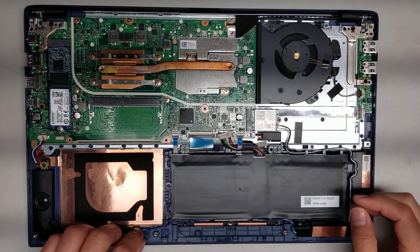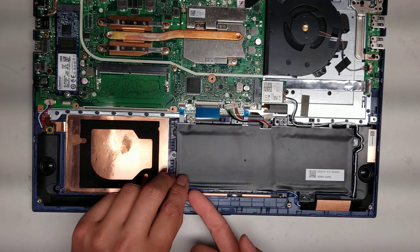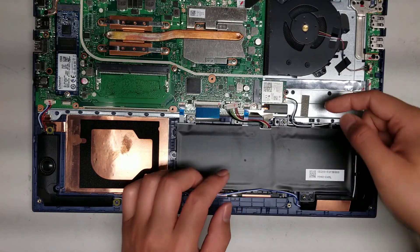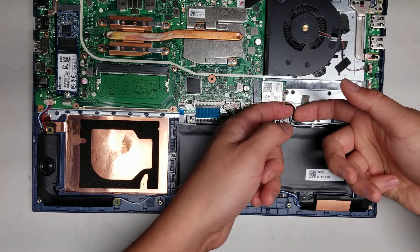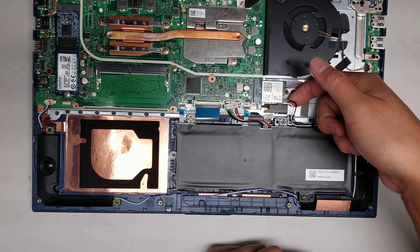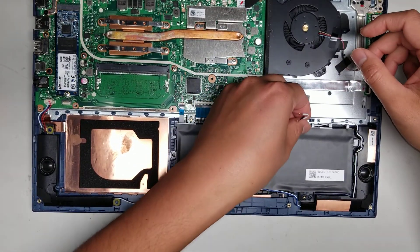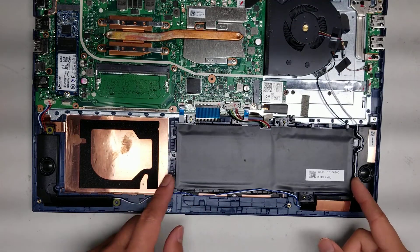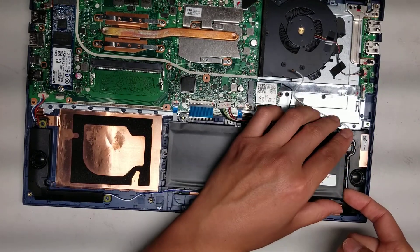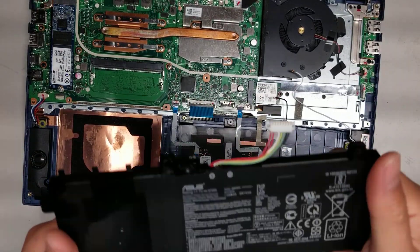After holding the power button, to get the battery out after removing the screws, you have to unhook all the wires. The speaker wire is routed through the bottom of the battery, so unloop that. The wireless antennas also need to be unlooped — go close to the tail and lift it up. Once all wires are unlooped, lift from the right side — there's a hook so you have to lift from that side first — and then you can lift the battery out.